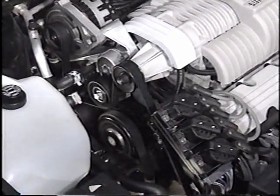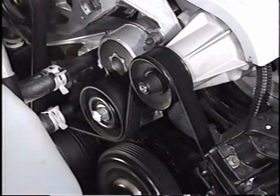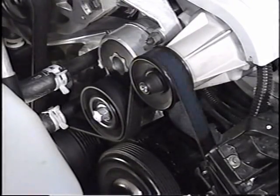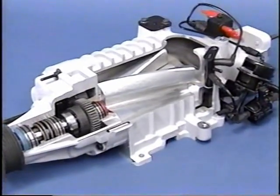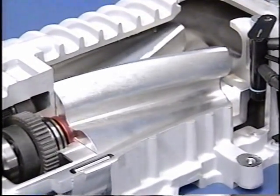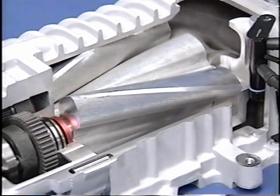Unlike a turbocharger, which uses exhaust gases to turn a turbine, the supercharger blower is driven by a modified engine accessory belt system, so supercharger boost is available at all engine speeds. The blower is a 62 cubic inch Roots type with two 3-lobe rotors. The rotors have a 60-degree helical twist that balances inlet and outlet pressures for quiet operation.